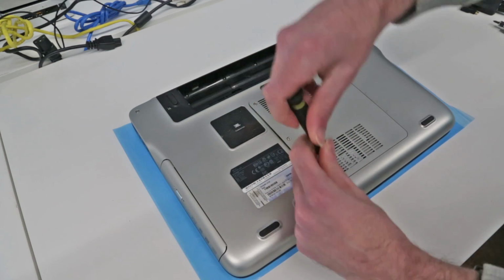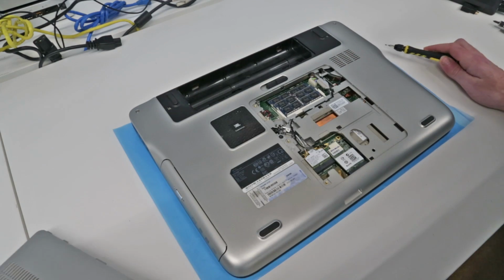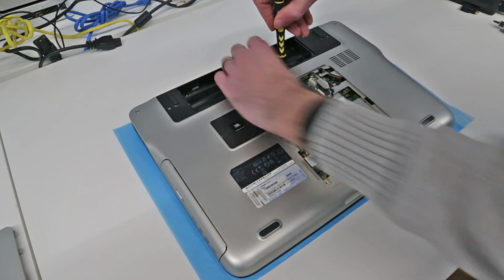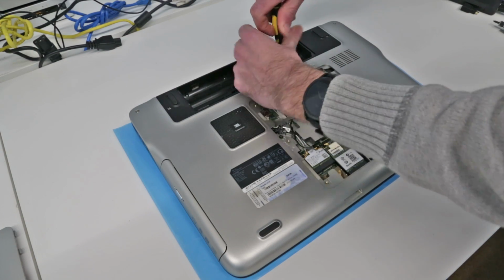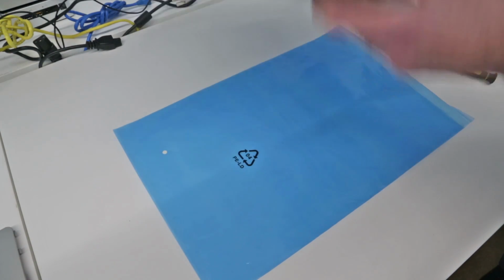As with some of the other Dells that we've looked at, they actually have some quite good service manuals for these available online. Again, I will try to remember to put the link in the description for this. So we've got that back panel off. We then need to take out this screw from underneath the battery and drop that in a ramekin just to keep it safe.